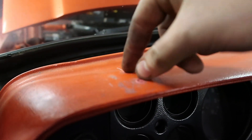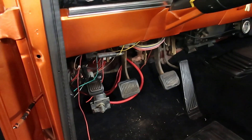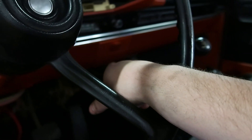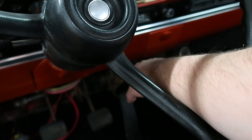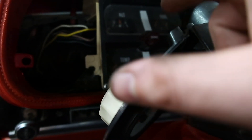It'd be pretty dumb to do away with the battery shutoff and then have a short in one of the old wires and burn this truck to the ground. We're still going to clean the wiring harness up a lot, but we're keeping the ghetto 5000. Got the tachometer removed — they put two screw holes in this dash for it, which I hate. I'm just tackling getting all this useless stuff out of the way. For now I'm going to install a little three-gauge pod down there for oil pressure, coolant, and voltage so it'll at least be safe to drive.